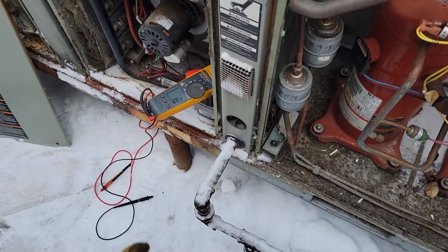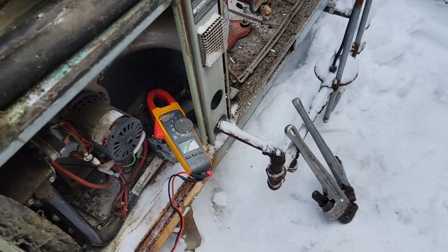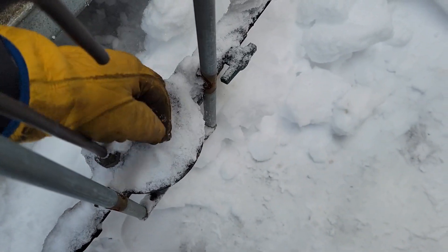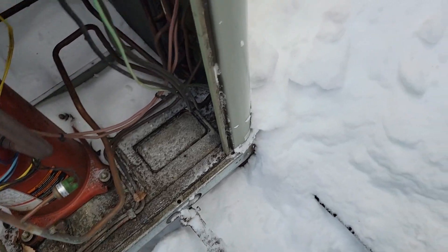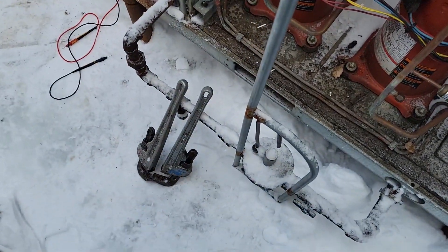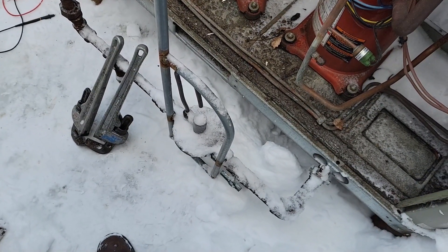Let's try that again now — it wouldn't surprise me if those connections weren't making good contact on the gas valve. There's that amperage but no ignition. Well, did I call it or did I call it? I can smell a little something coming out, but you should be able to hear it whistling Dixie. The regulator is malfunctioning — that's what I'm assuming. I see it happen sometimes on LP regulators. I would hope the gas has not been turned off in the back — no real good way to find out. I can smell a little something through there.